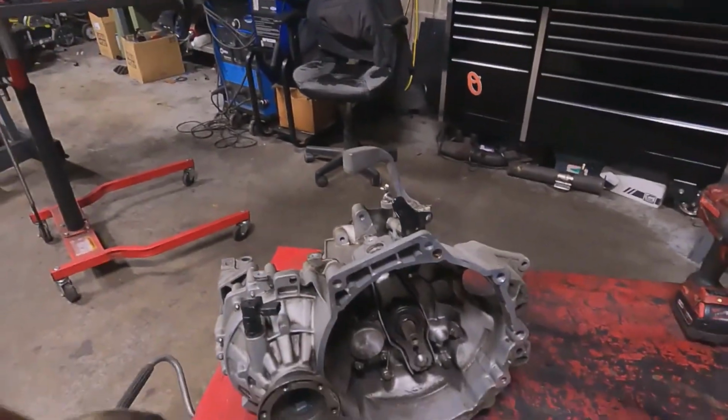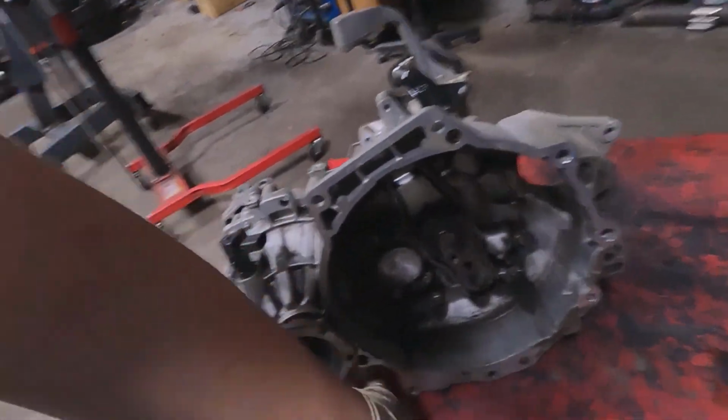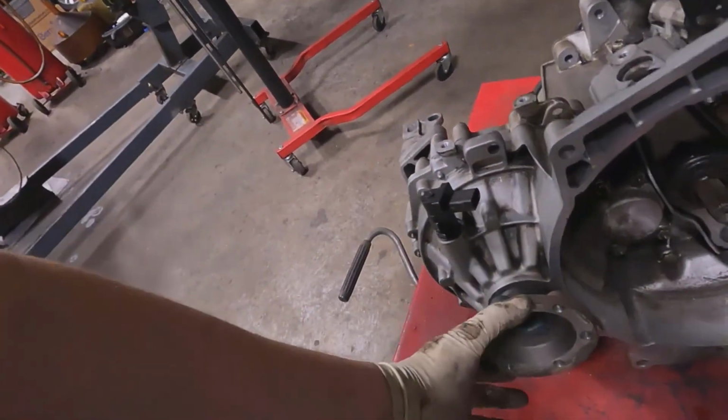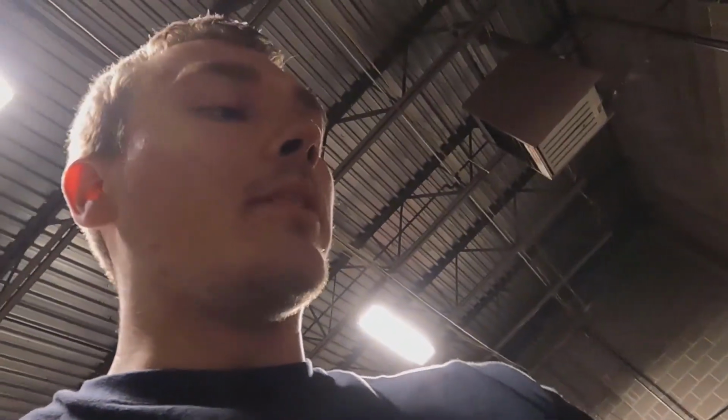Pull this cup off. These axle cups always have to come off when you put the trans on, because, as you can see, the bell housing goes behind it, so the engine and trans actually mate back here. So you got to unbolt that. I'll unbolt that, take it out. It's got to be swapped out for the 100mm stub anyway. I just have to put a rag or something in there because all the oil will come out.